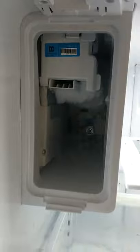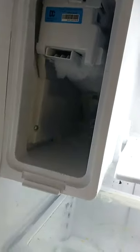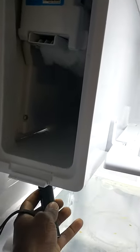And then you pull the bucket out, you also get this complaint about the ice maker freezing up. What's happening is air is getting in. You see the flashlight? Let me get this zoomed out. You see my light? You see all that light coming through there? That crack is all the way around there.